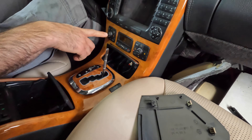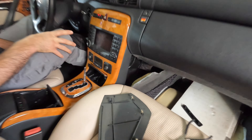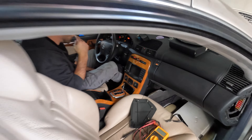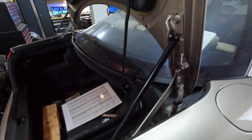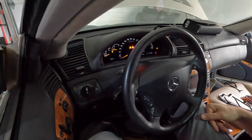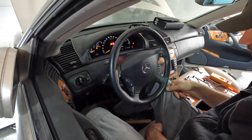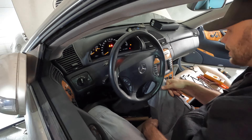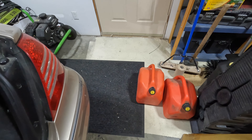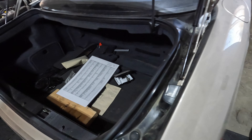Let's shut the climate control off so we can hear. What's next? Do we dare? There's still a little bit of gas in it — just under a quarter tank. We should put some fresh gas in with this gas and then we'll see if we can start this thing. We've gone ahead and put a couple of jerry cans in the tank, just because this gas is about five years old. That should dilute it enough.